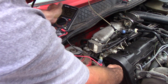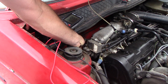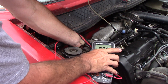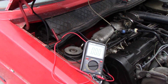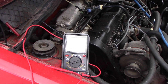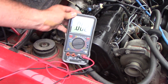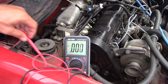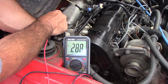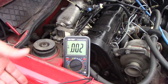If you want to do a quick check on the oxygen sensor, you can leave that ground wire in there and go to the big green wire down here. This is a pretty old car so it's not even a heated O2 sensor. Switch to DC volts. Our ground is still hooked up, and on the wire going to the O2 sensor we should be reading between zero and one volt, back and forth — it should constantly oscillate between zero and one volt as it adjusts the mixture. And it's doing exactly that, so I believe we're in good shape.